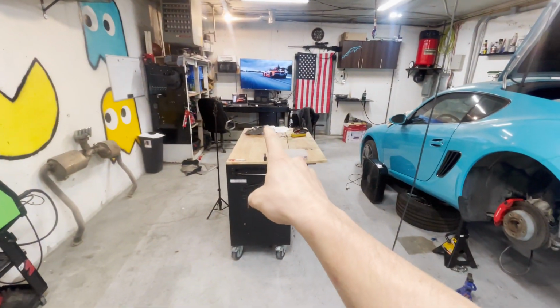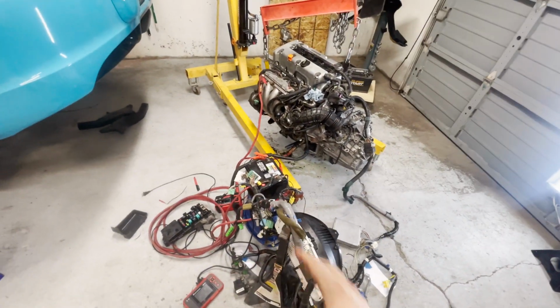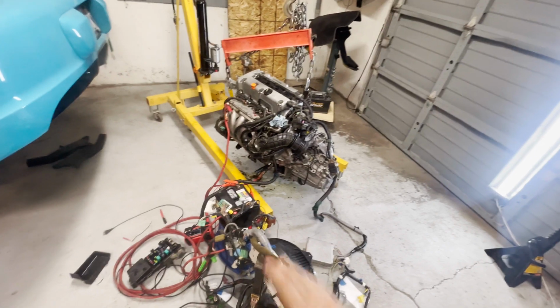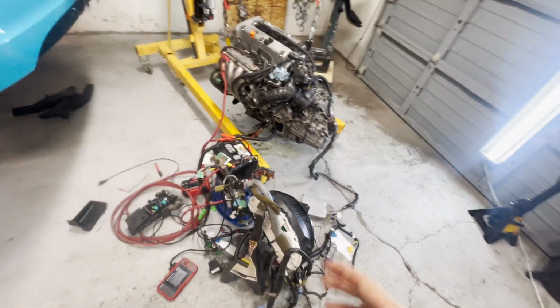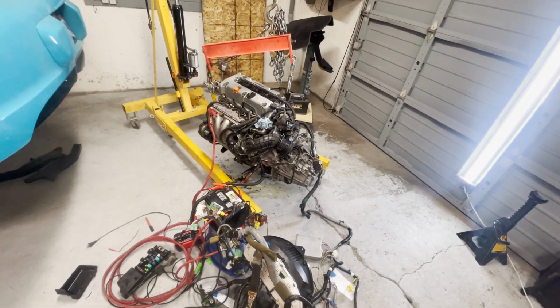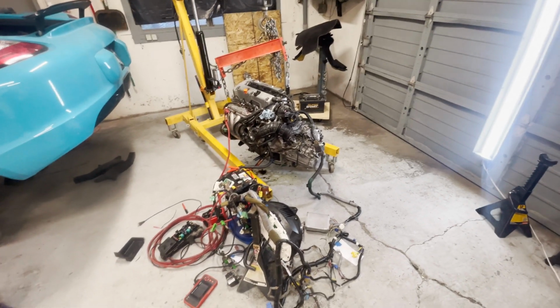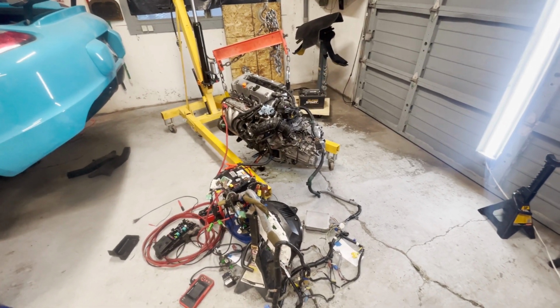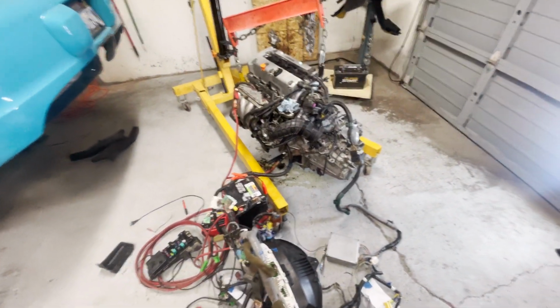And this system does not involve the fuel pump, because it's advisable that you power the fuel pump manually with some sort of switch, some separate relay, and you just don't have the ECU powering the fuel pump. Because it's not a duty cycle fuel pump, it's just a constant running fuel pump. It doesn't even have a return line on this engine, so I actually have to do that for this car. But again, that's a separate mechanical video, not so much an electrical wiring video.